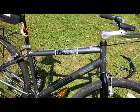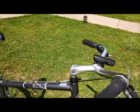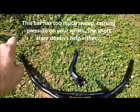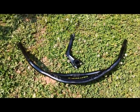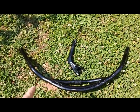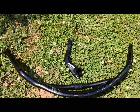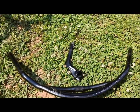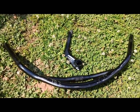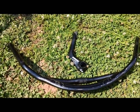I'm 5'10" and it was far too cramped for me. You can see Mongoose advertising that aluminum frame with chromoly fork. The first upgrade — the stock handlebar and stem — has a huge sweep-back design, more of a cruiser design. That bend really cramps up the bike and puts your wrists bent uncomfortably. The stem is a very short, stubby stem that cramps the bike even more. These had to go; I didn't even ride the bike with them on. I sat on it and knew instantly.